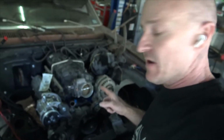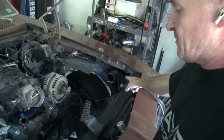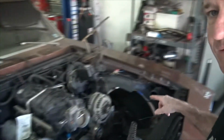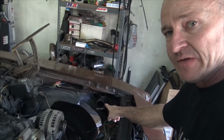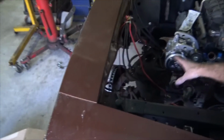We're taking the stock radiator, which had the feed coming from over here all the way across to the original GM spot. Well, now it's just going to be a short run right to here, and the bottom is a short run right to the same. And since we're reversing the flow on the intercooler, right here is the pipe that goes to the intercooler, and that used to go to the turbo, but now we're just gonna make a little shoop, and then a whoop that goes right here. We already got a blow off valve, so we don't have to do that. So that's nice and clean, and I'll keep that. And then over here we'll just have the turbo, and it will just shoot straight down to the turbo.